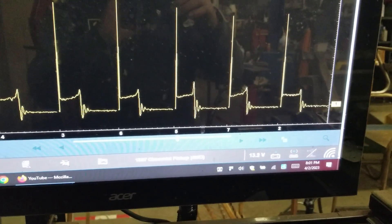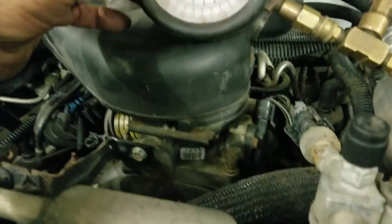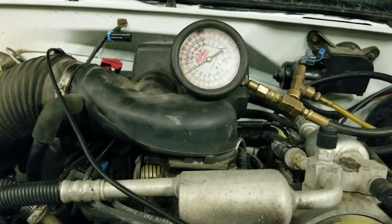So I'm going to go ahead and check that injector. I've hooked up my pressure gauge and put the spark plug and wire back on. The fuel pump, gas tank, sending unit — all that stuff is brand new, so this should hold pressure. And awesome — it's sitting right at 55.